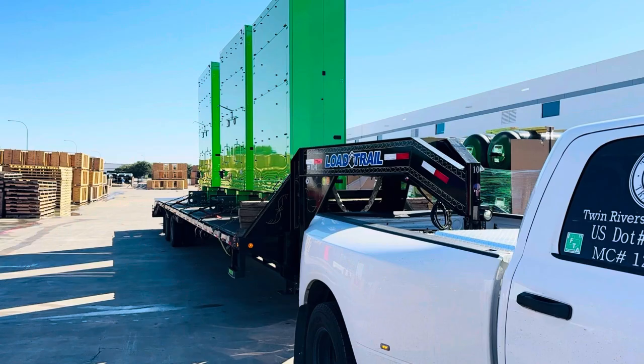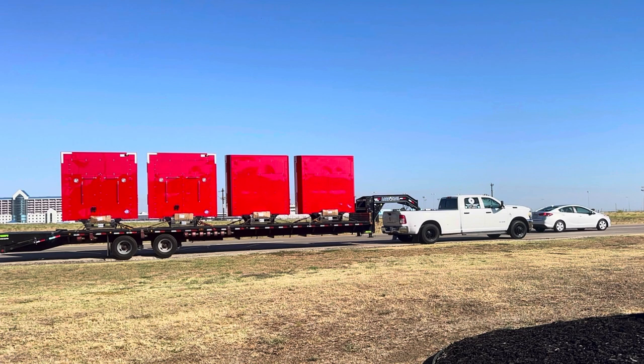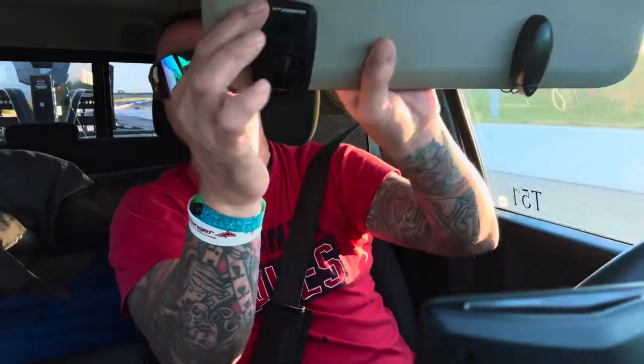So I did go buy another trailer. The reason why my last one, that Load Trail — awesome trailer, loved it, I bought it from a subscriber — but the reason I had to get rid of it is we're starting to do a little more over-dimension stuff. Those tanks we put on our trailer are 10 foot 7 inches tall. When you put them on a trailer that's 39 inches in the front, it puts you right at about 14 foot. I know 14 foot is still legal, but it's only legal from Texas West. You go Texas north and east, it's 13.6. When my truck blew up the second time, I sold it and took my time finding a trailer, and I found this BigTex.